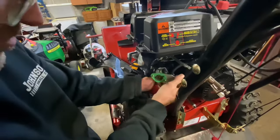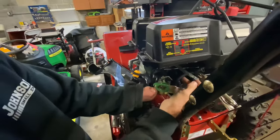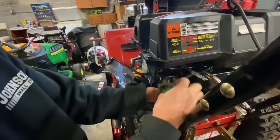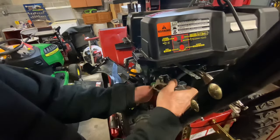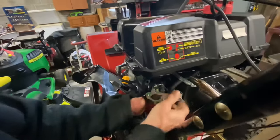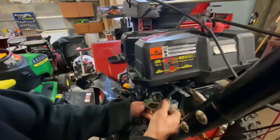This is a little tricky because the choke bracket comes up and it goes behind the fuel line. So we have to get that fuel line off, but first we're going to take that bracket down out of the way. There is no air filter on snow blowers because there's no dust when it's snowing — they figured why put one on when you don't need it? Now I'm pulling this carburetor out a little bit so I can get things off because everything is still connected.